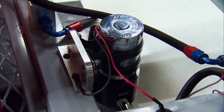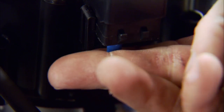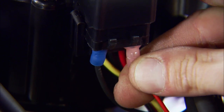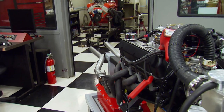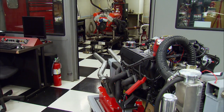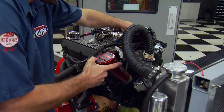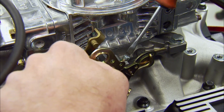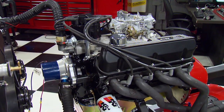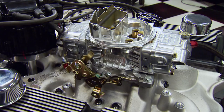Next, hit the power switch and the fuel switch, then check for fuel and water leaks. After connecting the tach wire, we're almost ready to fire it up. Here's an important safety step: when running any engine inside, you've got to vent the exhaust system to the outside — in our case, we'll use our dyno's exhaust fan. First thing is to set the initial timing to 10 degrees. Then raise the engine speed to 1500 RPM and let it rest there for 15 to 20 minutes for proper cam break-in. This will also allow all the gaskets and seals to get a good heat cycle. Once break-in is done, we can set the idle to 825 RPM.